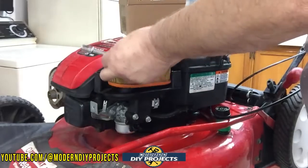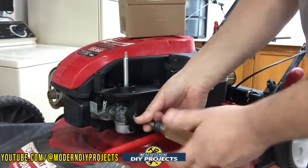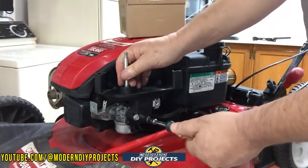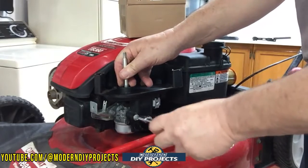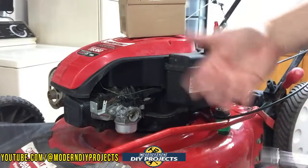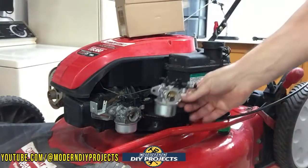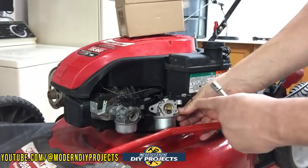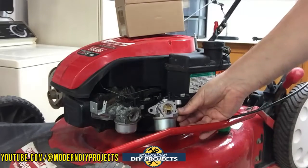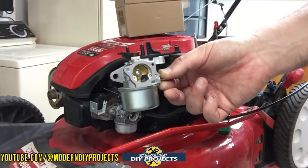The air cleaner comes off, then the filter, and this housing just has a couple of nuts — use a nut setter and it comes right off. The problem with this carburetor is that the needle and seat are so badly corroded by water getting in that I didn't feel comfortable just cleaning it. I think it would start overflowing and gas would leak all over the place — I just didn't trust it. So I decided to replace it with this new carburetor here. It looks pretty much identical to the old one, which is a good sign.